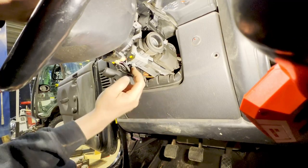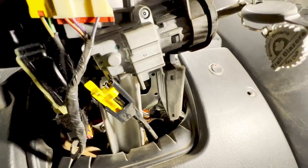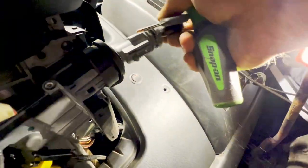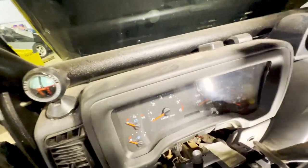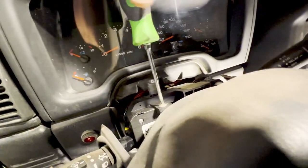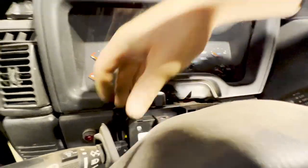The next step — this cover has a cable lock on it; we need to take that off next. Let me show you guys that button. You push that right there, and that allows the lock cylinder to slide out. Once you pull the lock cylinder out, you've got to remove the multi-function switch, which are these two screws. Once you have those two screws out, the switch should just pop up.